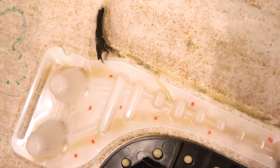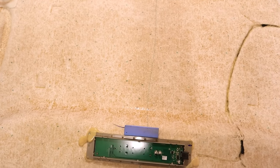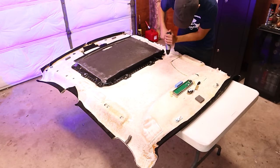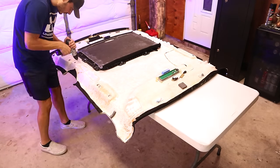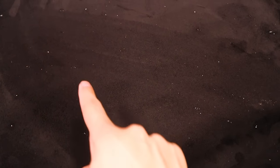This kit comes with drill bits to make the job easier. I'm going to take this to the garage, attach them to the drill, and wherever I see a dot, make a hole. This is not hard, it's just going to take some time. When drilling, the only thing you need to think about is keeping the angle straight so the cables have an easier path to follow. The glue says it dries in about an hour, but if you're adding starlights, I'd suggest getting a full day of sitting before starting this step. And if you're worried about seeing the holes — you can see them right now, but as you realign everything they start to disappear.